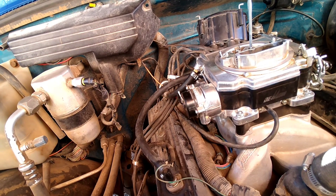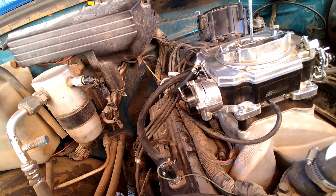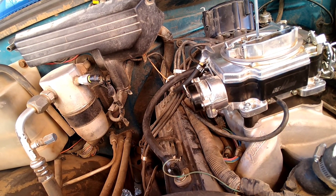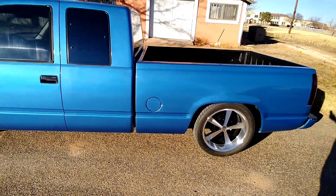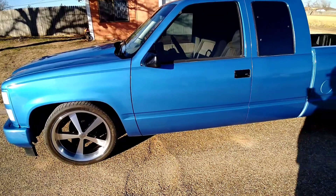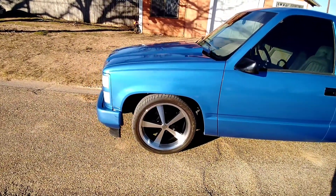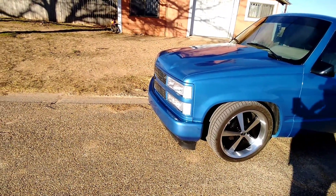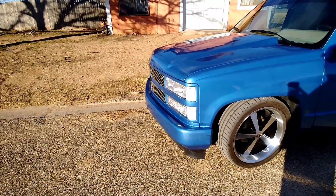The first time we moved our little lockout screw, I guess when the engine was running it moved the screw back to the flat part. So what we're going to do is put another drop of glue so it'll hold it. I took it out for one last rip and it seems like it runs the best it's ever run at about 18 degrees initial timing and 32 overall. It really, really liked the 32 for sure — it pulls so much harder from 3,000 to about 5,600 RPM with the timing set at 32.